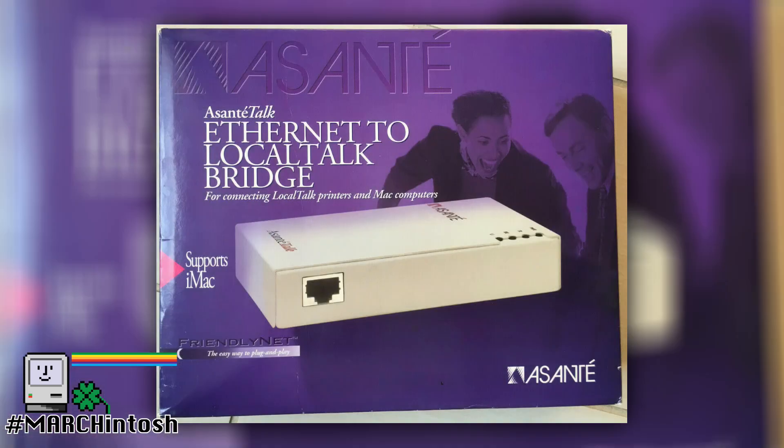Here's the skinny. The Performa 410 only has serial ports, and the iMac only has Ethernet ports. But both of them support AppleTalk over the ports they have. So to get them to see each other, we need a translator called a bridge. In networking, a bridge is a device that allows different physical network types to communicate. You can do this with a device specifically designed for it, like Asante's AsanteTalk or a Farallon Star router. But the most accessible way for the modern retro enthusiast is using a Mac with both a serial port and an Ethernet port, in combination with a software extension called Local Talk Bridge — we get the magic we need to make a virtual golden gate.